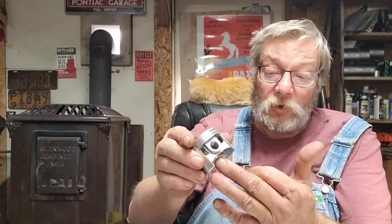As the piston comes down in these saws it builds case compression and comes out the windows in the piston — there is where your problem is every time. Even the 272 Husky, 268 — all saws that have windows — be careful, you don't want to lose strength. But there's always room for improvement. When we get done with this piston and do all the little go-fast things we do, it'll make it last longer. Well, I don't know if it's possible to make them last longer — these dinosaurs run slow for a long time, wonderful saws.